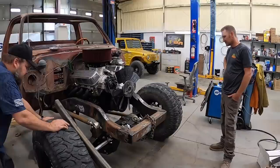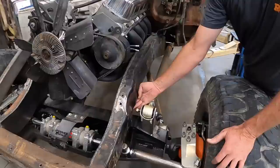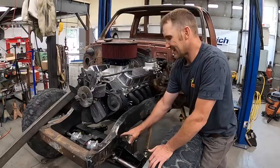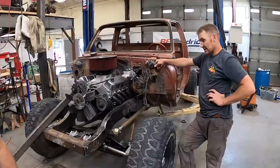Yeah, we're just gonna chop it off right there. We're just gonna saw it off. All we're doing is we're gonna make the original part of this frame rub. It's gonna hit that. But from here out, it's gonna come up to our 2-inch that's coming out of here and then 45 down. So it just barely misses the steering, back out, crossed. Yep. Guess get the old Sawzall out and vibrate your arms off.